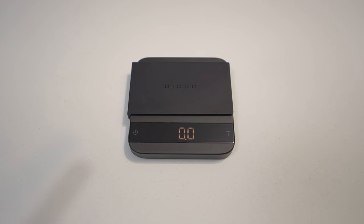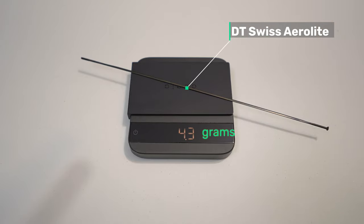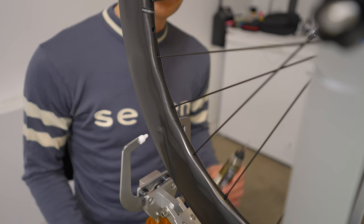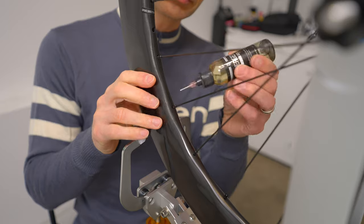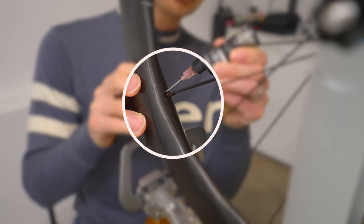For the opposite side of the wheels I used DT Swiss's lightest spoke, the Aerolite. Generally I found that the lighter the spokes, the tougher it is to tension the wheels during the truing process. The first issue is that the spokes tend to wind up more easily, so you have to be really diligent in prepping the spokes and nipples properly and not over-tensioning the spokes. This is where you really want to make sure to add a drop of lube to the nipple and rim contact point to lessen the friction on the nipple.